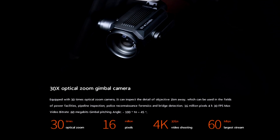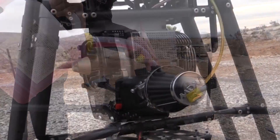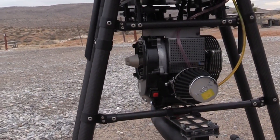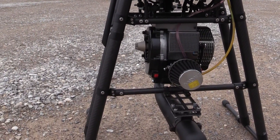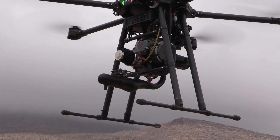Lucy's colleague Mr. Shaw mentioned that because of the gasoline engine there is periodic maintenance required. After five hours of flying you need to check the air filter and make sure all the screws are tight. After 50 hours you check the spark plug and replace the air filter. After 200 hours of flying, that's when you take it apart and check everything inside. The engine is imported from Japan and the quality is very good.